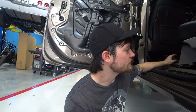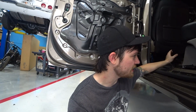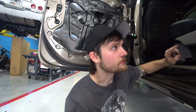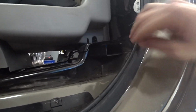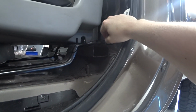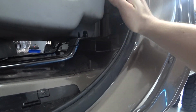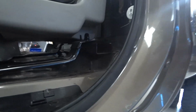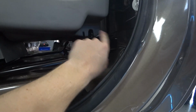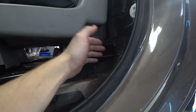So what I'm going to have to do is cut out the mounts for the previous seat and the seat belt, but I have to weld up a mount for the seat to fit in here. I think this 2x4 square stock is the perfect size, height and stability. It's strong too. So I'm going to pull the seat out, take this, and cut it to the right length. I got a long piece that I can cut to length.